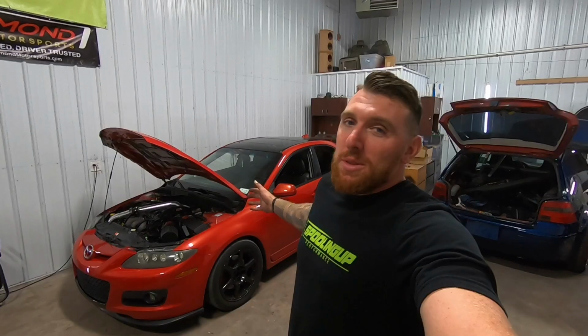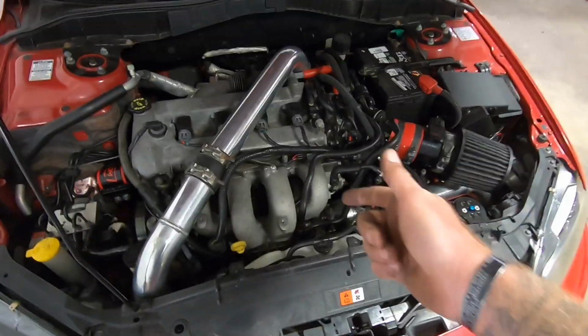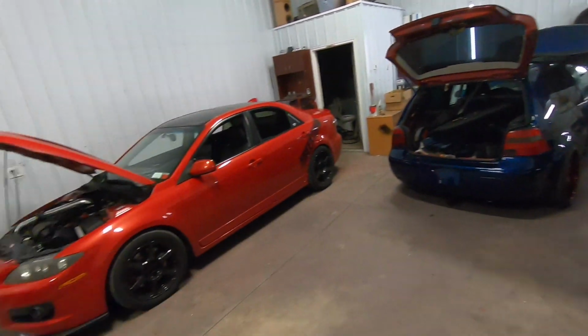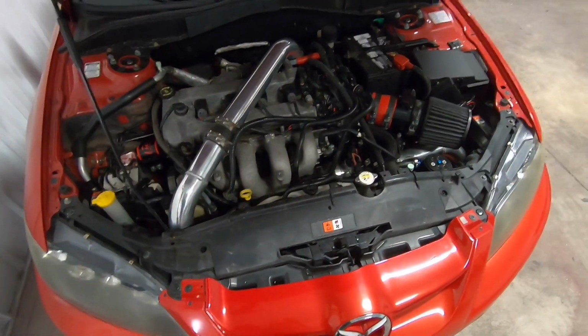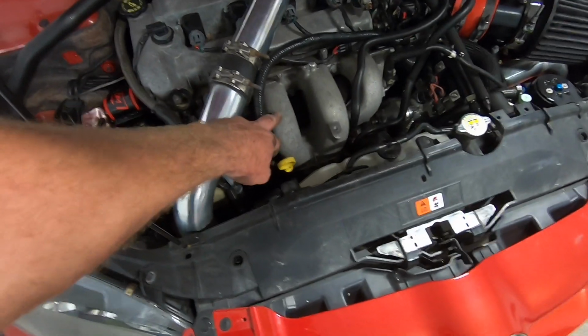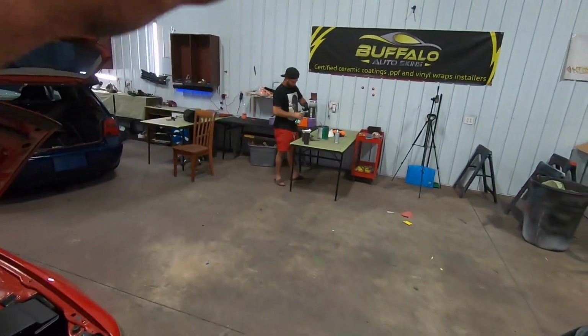Today, we're gonna be tearing down the Speed 6. We're actually gonna be taking down the engine bay a little bit. All the charge piping, valve cover, intake manifold, all that is coming off. And my man Austin over here is currently mixing, Sir Mix-a-Lot, with the paint primer. We're gonna be painting some of the stuff in the engine bay, kind of dress up the entire area. As you know, we got the RACETHETIX valve cover kit with all the hardware, the fender bolts, all that good stuff. But what we're gonna do is take off everything first. I'm actually gonna take these to my work and use a sandblaster and sandblast the cast down to as smooth a finish as I can, so that Austin can lay down some nice paint and have it look legit.